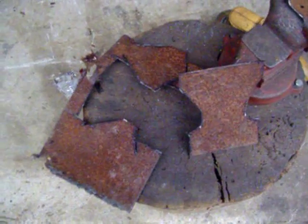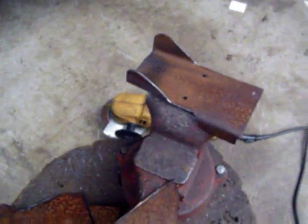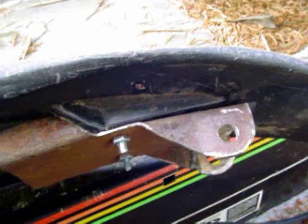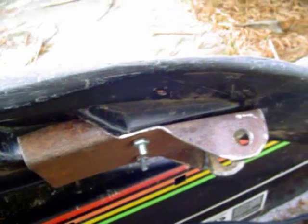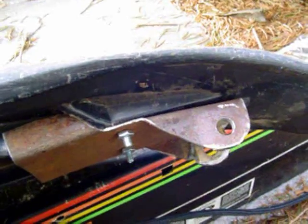You just need some scrap plate and you can cut some brackets out. Once you get the profile you just bend them. There might also be some trimming around the back to get your rear spring mount mounted flush and flat along the ski.